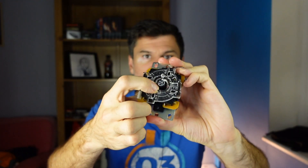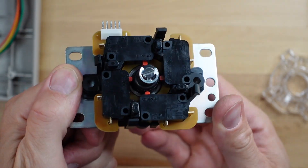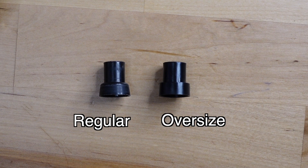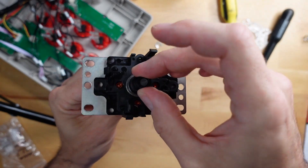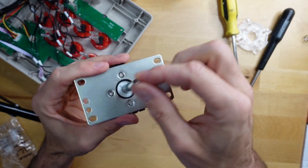The final simple mod I'll suggest today is to get an oversized actuator. The actuator is the part attached to the shaft that actually hits and engages the microswitches. The idea being that if the actuator is larger, there's less distance to engage the microswitch — basically less movement needed to click it, so you need to move the stick less, or it's got less throw. I find it easier to control in bullet hell to make those very precise movements. It's pretty easy to replace: when putting the stick back together, you put the shaft down, put the spring over the top, the actuator goes on, then you put the E-clip to hold the whole thing into place.